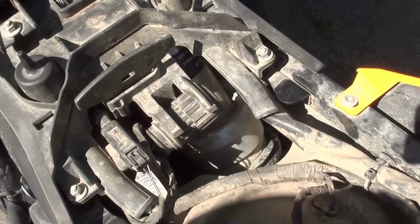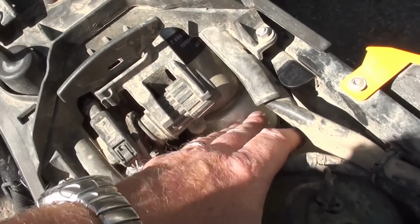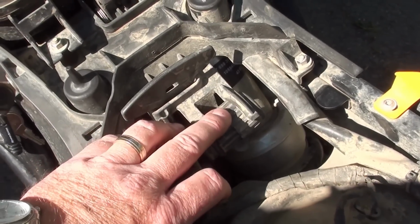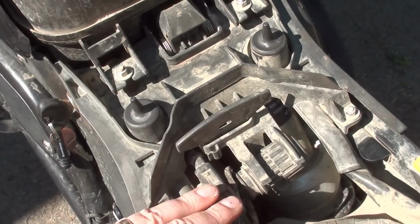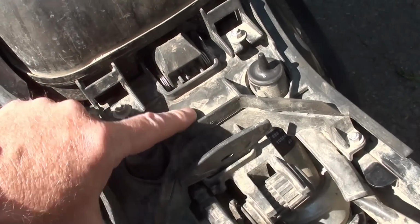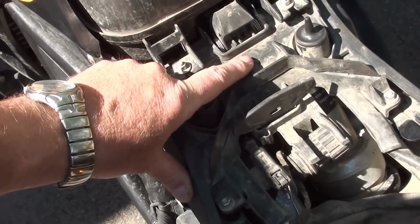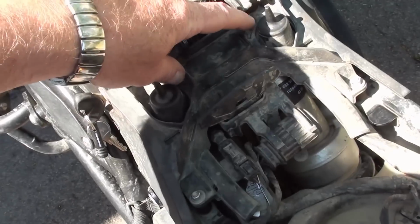Now here we are, we've got the seat off, and if you look down here you can see the rear shock. This is your diagnostic plug so that the technicians can plug in to the computer and talk to your bike. And the weak link of the suspension, the real weak link, is under this plastic cover. You remove these 4 bolts, you take this cover off, and this is where the top mounting point for the rear shock is. And if you give your bike any sort of abuse, you will bend that bolt. There's a big long bolt under here.